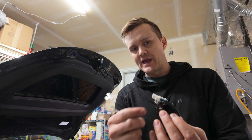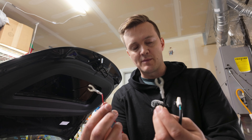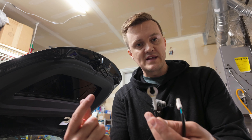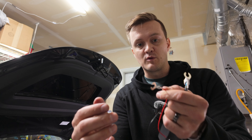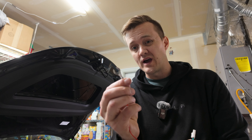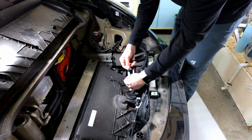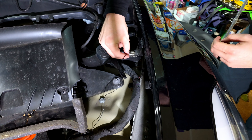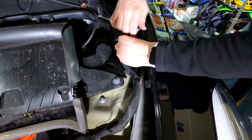Let's take a look at the wiring harness before we put it in. We have three different connections: this connection goes to the motor, then there's a red and a black wire. The black wire we're going to connect as a ground to some bolt connected in the front of the car. The red wire has a little inline fuse and will be connected directly to the battery itself — we'll loosen up the battery terminal a little bit, slide that in, and tighten it up. The main connection goes right here. I'm running the wires all up along the side, loosening this bolt for the ground, then coming up to where the battery is and connecting it right there. Connect the motor by plugging male into female. Take the black ground wire, slide it underneath the washer, put it down here, and tighten that up — keeping the wire pointed toward the side of the car so we can tuck wires in along the side.